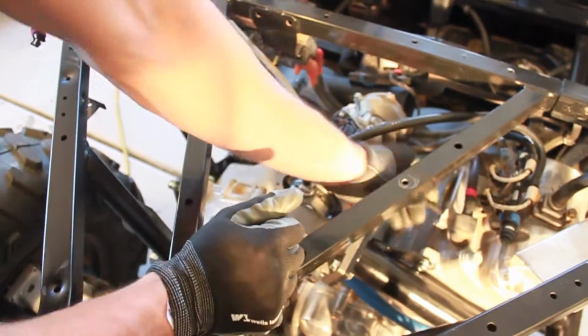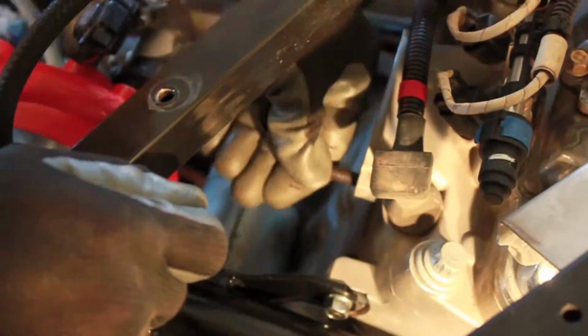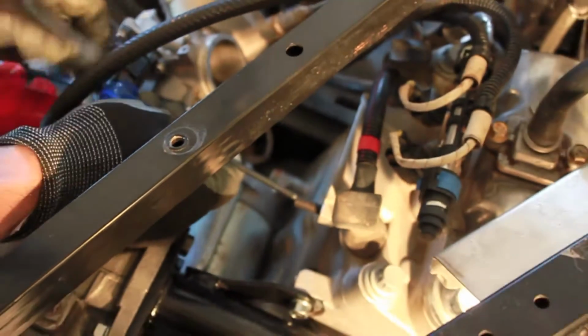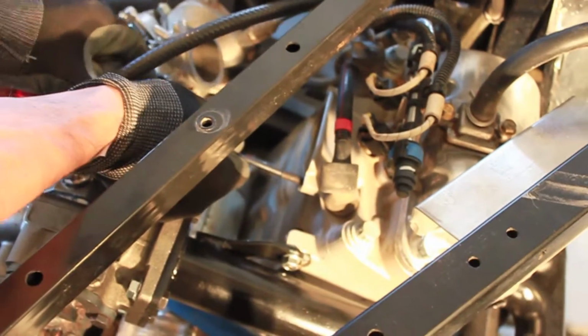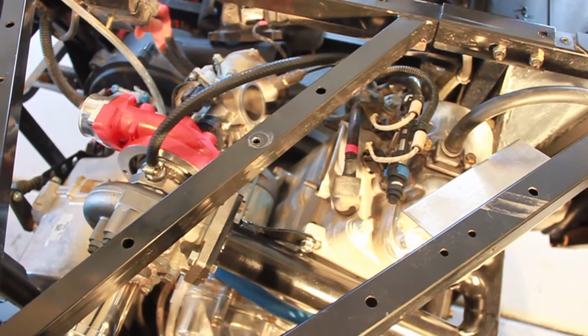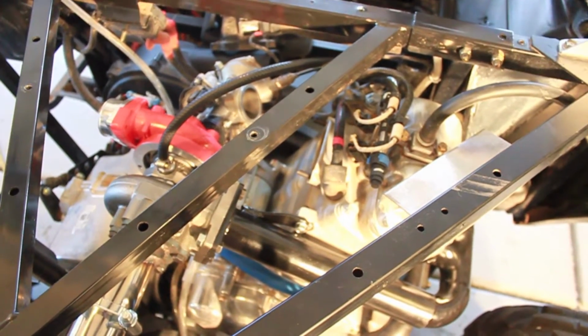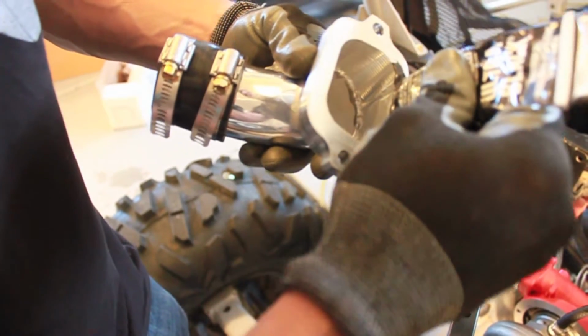You're gonna put these studs in the two bolt holes for the manifold. Snug them up just a little bit with the 4mm Allen wrench. Doesn't have to be that tight, just good and snug. Then you're gonna wanna apply, again, silicone to the base of the manifold where it's gonna meet up to the cylinder head. That way you don't get any air leaks or boost leaks.